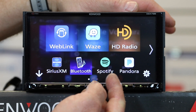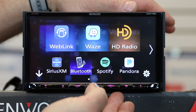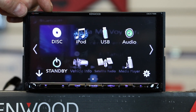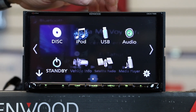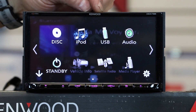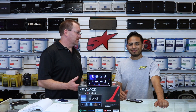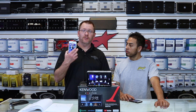Spotify and Pandora are controlled from your smartphone — the radio just launches the apps on your phone. It plays CDs and DVDs and supports direct iPod control. The USB plays DSD, WAV, FLAC, and MP3 formats, and is also used for the Weblink application. Weblink is an app you download to your Android or iPhone. Once Bluetooth is paired, you also need to plug in the USB — it needs both in order for the app to work.